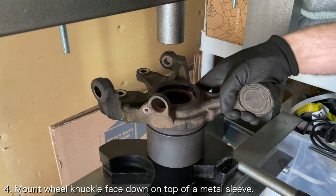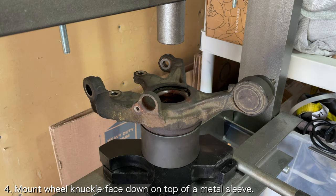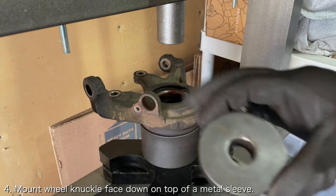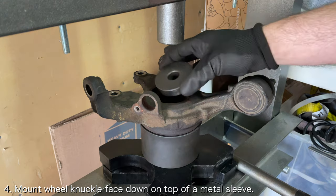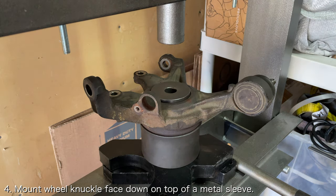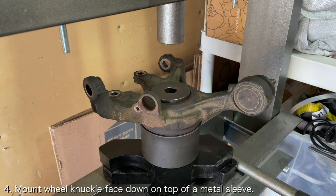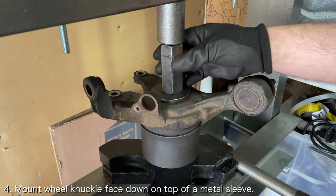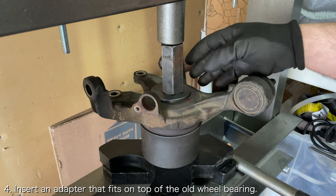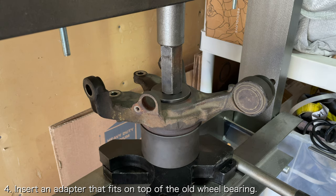Mount the wheel knuckle on the press so that the outside of the wheel knuckle is facing down. Ideally, you'll want to mount the wheel knuckle on a metal sleeve that is wide enough to support the wheel knuckle and also the bearing to pass through. I'm using a metal sleeve and adapters that came in a front wheel bearing removal kit that I'll link in the description box down below. Insert an adapter that fits just on the wheel bearing and use a hydraulic press to push the wheel bearing out.